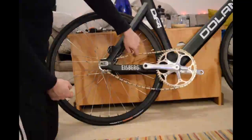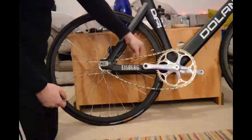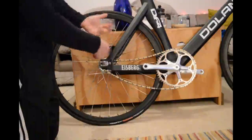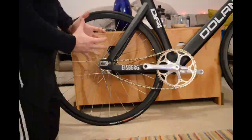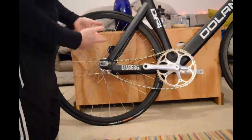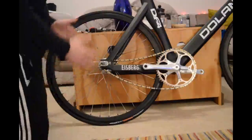It shouldn't be super tight — you should have a little bit of jiggle in it still. If it's super tight it puts a lot of stress on the components, everything sticks together, doesn't spin freely, and it wears out all the parts really quickly.